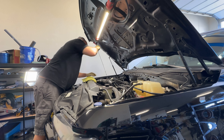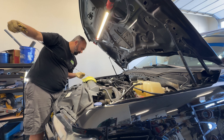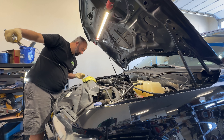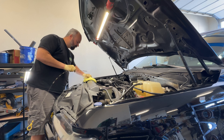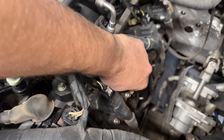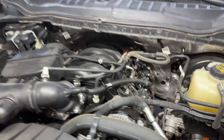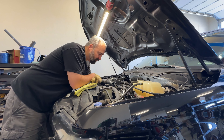This isn't a BMW, so I don't imagine it's going to be losing much oil, if any. It is however low. So perhaps at 75,000 miles it's consuming a little bit of oil. The oil itself is quite clean — looks all right. We are about a quart low, which is interesting to find. Then go ahead and pull what looks to be the smallest oil fill cap ever off. Down, we're going to look at our belts. You should have the truck running — take a look at your tensioner, see if it's wagging all about.